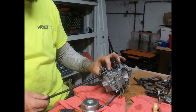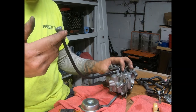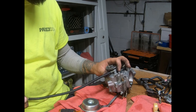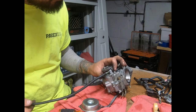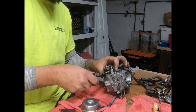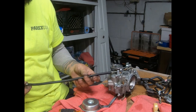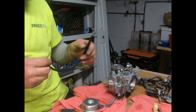So I'm over here on the second one now. This is your idler, or your idle adjustment. Just wind it right out, keep the spring and everything on it. It doesn't need to go in the cleaning - this is an external part. I'll just wind it right out and we'll get it back in there after we're done, just to keep it out of the way.